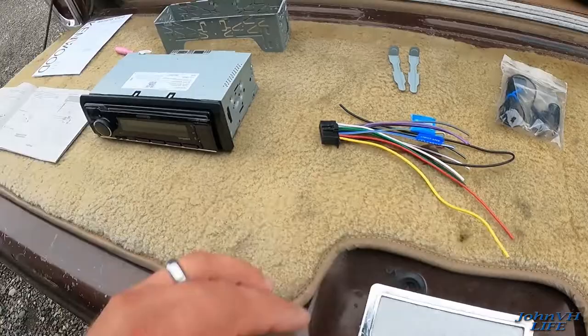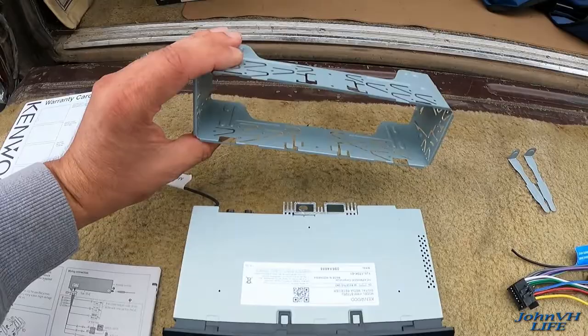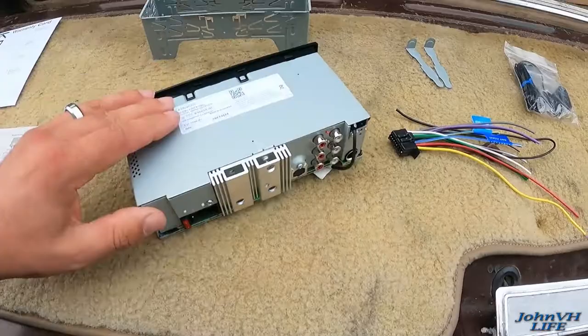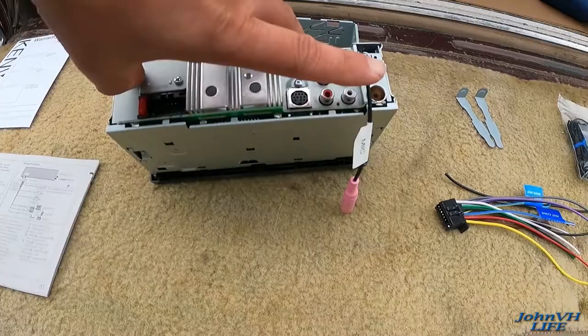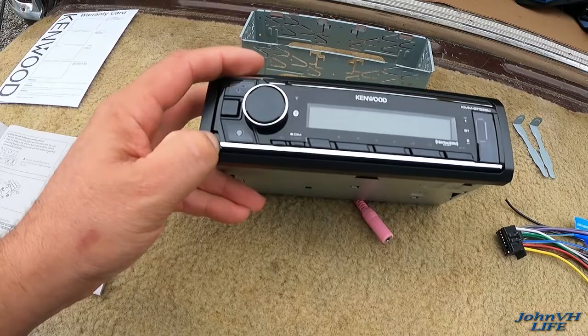The purple, gray, white, and green wires will be your speakers. You've got your red power wire and the yellow is probably the switchable constant. You've got a manual. This is 50 watts by 4, by the way — I did look it up. It's a nice-looking unit. Here's the piece you're going to install in your dash. It weighs literally nothing and it's very small because there's no CD player. Here's where your antenna goes in, and for amps you've got your RCAs.